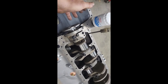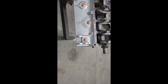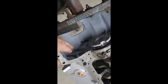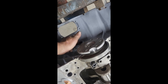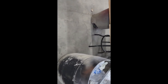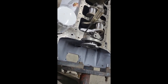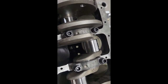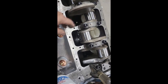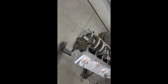RTV needs to cure, then final torque. I don't have the rear cap for the cam yet — need to get in there and clean it out. I don't have quite enough clearance to get a good marking on it. Using a screwdriver to run the crank up against the thrust bearing, get all the caps straightened out. That's about where I'm at — trying to get her assembled up and hopefully get the pan on it.